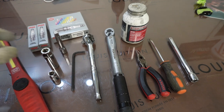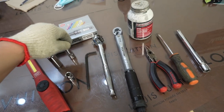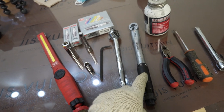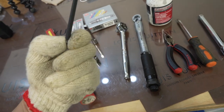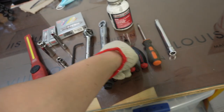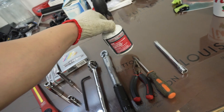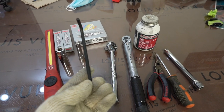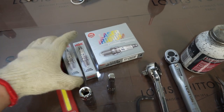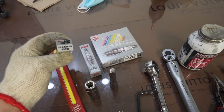The tools for today's job are pretty straightforward: a standard 5/8 spark plug socket with the rubber gasket inside, extensions, 10mm, torque wrench - the smaller one, inch not foot pounds - ratchet, allen key, pliers, flathead screwdriver, and some anti-seize and extensions. The allen key size is a five - some references say it's a six but it's actually a five.